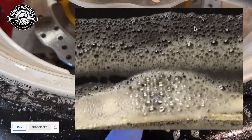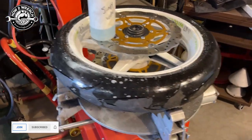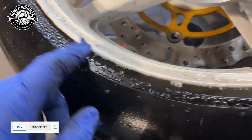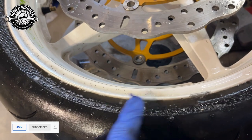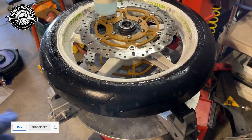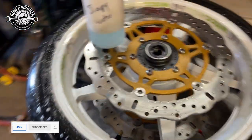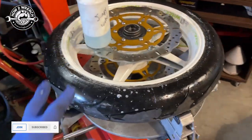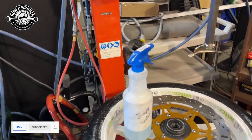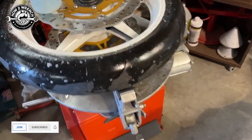The fact that these bubbles are just sitting there and holding the retention of the soapy water — that's a totally nominal situation. If you're struggling with that, there's your little tip. What you want to do is just keep going along checking this. What I like to do is just let the tire sit, throw it on, walk away, do something else, and you can come back and do two things: look for those bubbles, and then check that the PSI is the same that you put in. That's a good way.